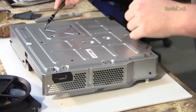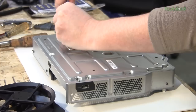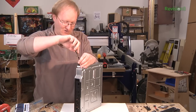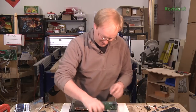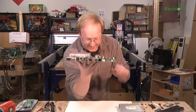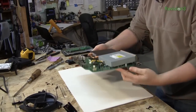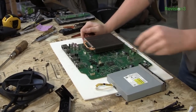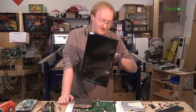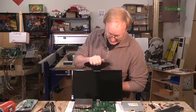Just like the Xbox 360, the final step is to remove these screws from the APU — I keep wanting to say CPU or GPU, but now it's an APU. I'm never going to put this thing back together — you all know what's going to happen to it. I think this would be fairly conducive to making into a portable. Think about it: you can make it pretty thin, and the drive is a lot smaller than the previous Xbox model. The main challenge you'd run across making this into a portable would be the screen. This is one of the smallest LCDs you can really even get, at least in complete form, and this one is only VGA — it wouldn't work with this because Xbox One only has HDMI.